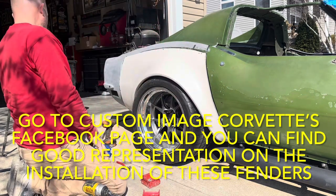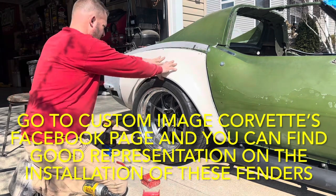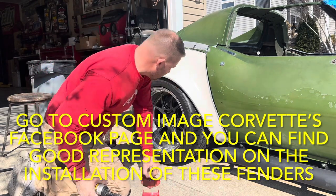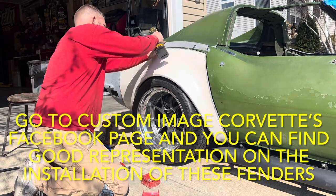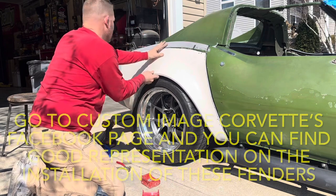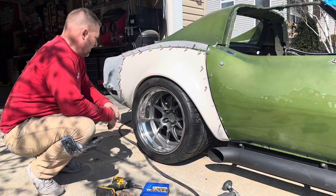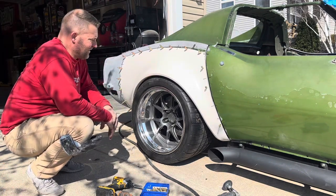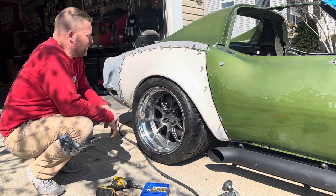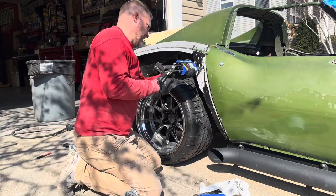I'm just trying to find fitment. The car is leveled and set up, so getting this where I want it is really important — right height, set. Everything's trimmed back to where I can set this flush and put it where I want it to stay for good. Making sure the wheel's centered in the opening, making sure the body lines meet at the middle of the door, making sure there's no obstruction at the bottom of the fender at the rocker — so on and so forth.